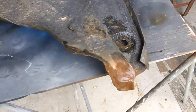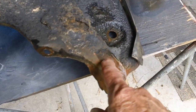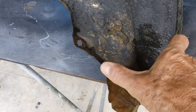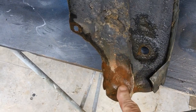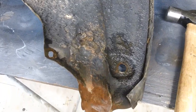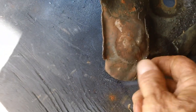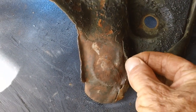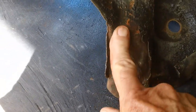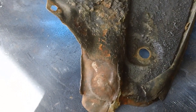The alcohol has cleaned up the other side pretty good. But before we turn it over and spray it with the rust reformer, I've got to bang out right here — this is where the fender comes down and meets the underside of the car. This has been bottomed out several times, so I'm going to bang it out with my ball-peen hammer so it conforms all the way down. There's a real bad crease where it's been squeezed together, almost a ridge, but it'll have to stay that way. Once I get it sprayed with rust reformer, painted, and undercoating over the top, I think it'll be okay. Let's flip it over and start spraying.